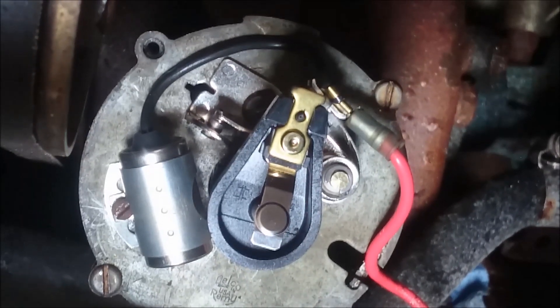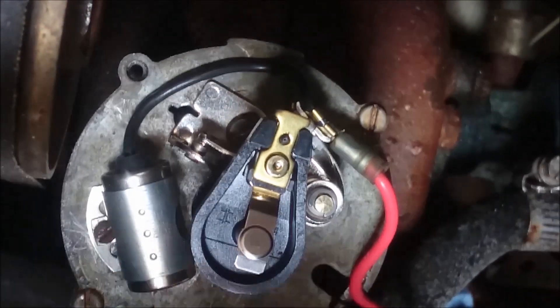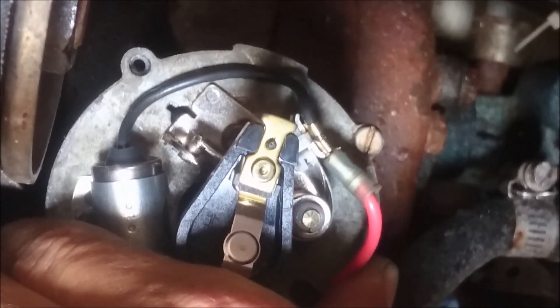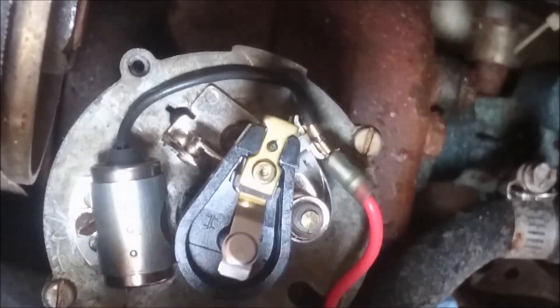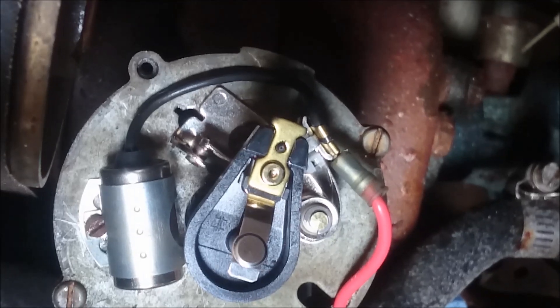A way to do this is you can actually turn your key on — just don't ever leave it on for longer than about a minute and a half. But as you rotate this slowly backwards, it will make a ticking sound and you might see a little spark there. The moment you have that, that's exactly where you are going to have fire.